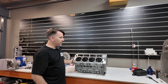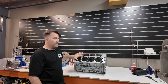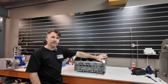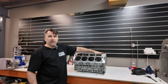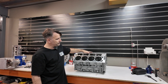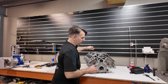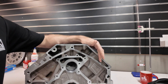The advantage of having a perfectly align honed crank tunnel is we then index that to machine our deck, and that deck is then 100% square to the crank tunnel. We do machine the valley surface just to clean it up — it's mainly a cosmetic thing. And we also install Durabond cam bearings; a camshaft is test fitted and spun.